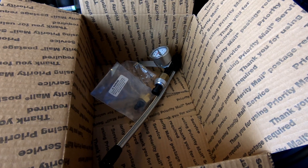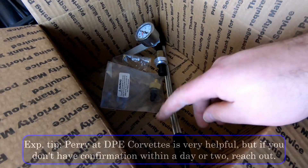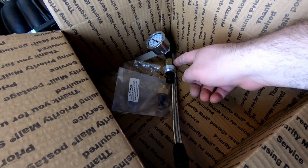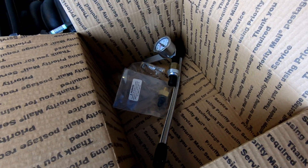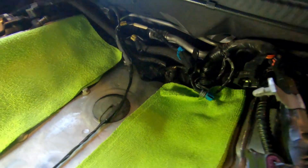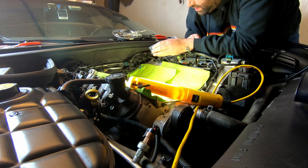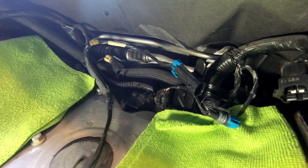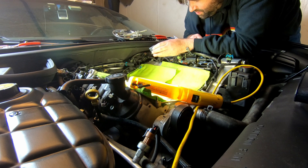After a little waiting, the kit finally came — unfortunately with COVID, USPS is slow. This is what I ordered from DPE Corvettes. You can see the relocation line, which runs from where the current sensor is and adds an analog pressure gauge in the engine bay. This little silver piece is a new sensor, which is nice that the kit includes one. Also included is the adapter so the new line can run. I've covered the heads with lint-free cloth to keep dirt out while I get this sensor out — it's quite a pain to reach with the manifold on, but with it off, not so hard at all.